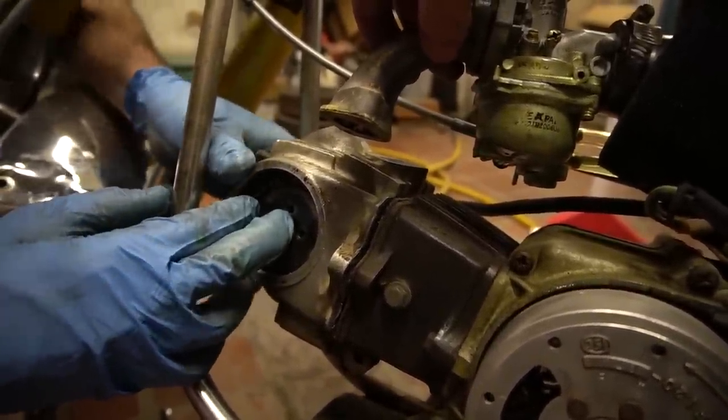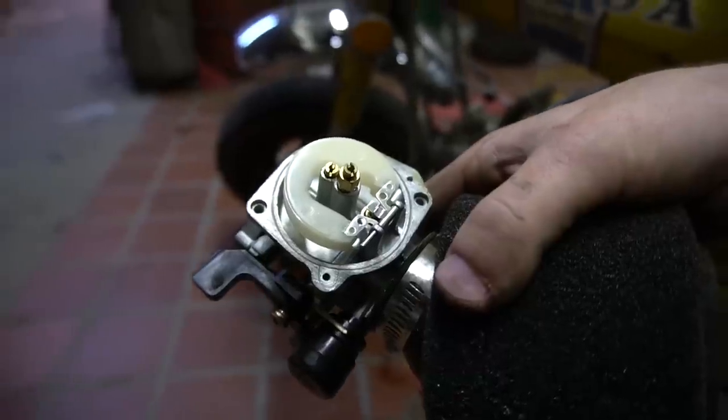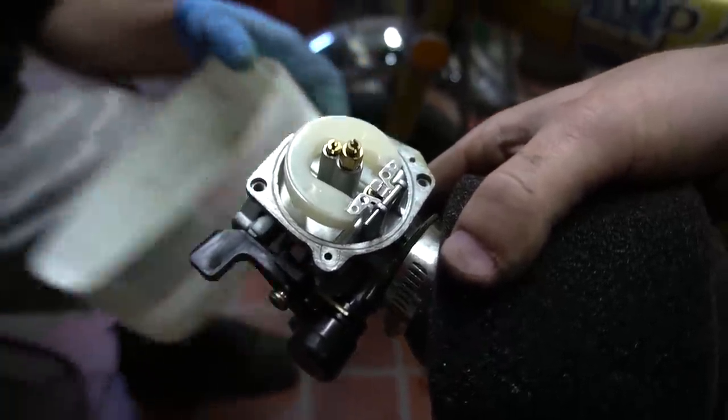Yes. We were hoping to upgrade the carburetor at the same time as doing head work on this bike. My bike has a 110 carburetor from GoPowerSports.com, and that's why we think it does so much better than this bike, now that we know that this did not have bent valves. But for right now, just drilled out the jet. We're going to see how far that gets us.